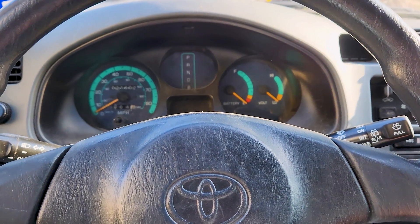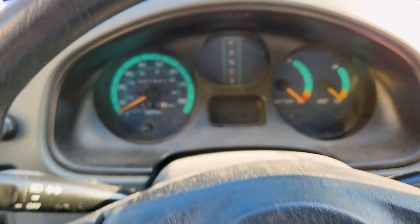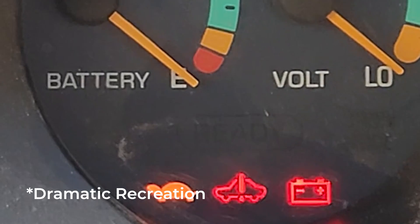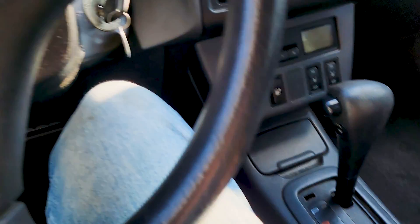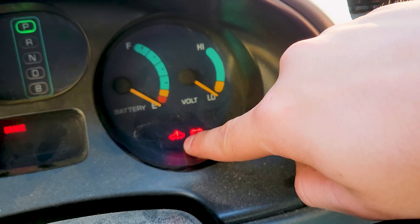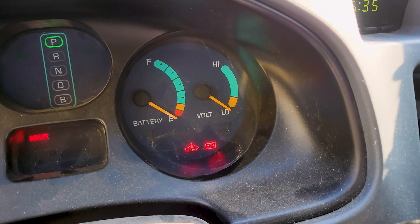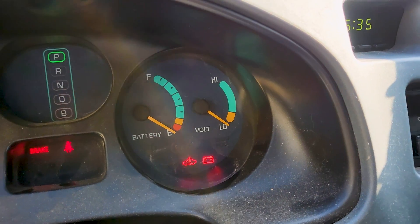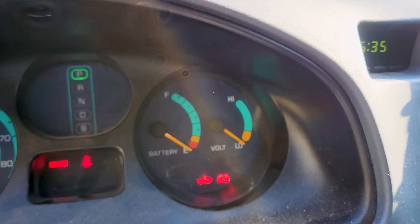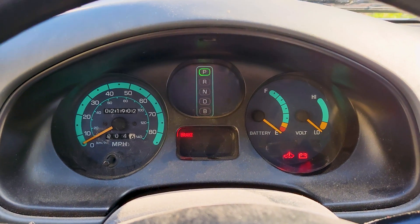Now I want to show off why I think the battery in this car is done. I put a new 12-volt in the car. We've got our Toyota key — no buttons on it, just a normal ignition. The ready light flicked on and off really quickly, and you could actually hear a contactor in the battery pack close and then immediately reopen. We have a warning light of a car with an exclamation point — that means something's wrong — and a big red battery warning light. We're reading completely empty on the battery and completely low on voltage. This battery pack is not having the best time at the moment.